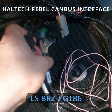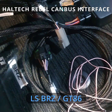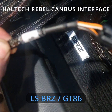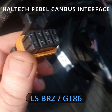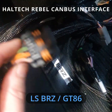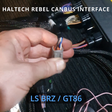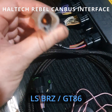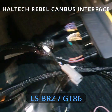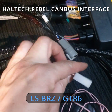I've got some plugs here for extra IO - we don't need anything for this at the moment, but you might want to add some features which you can add into these plugs here. The one we will need is this plug here, which is the one that used to go to the accelerator pedal - this will go to the translator, and the translator will then go to the pedal. The other plug we've got is the CAN bus plug, which we'll need to go to the translator as well. There's also a pink wire here which is the ignition on/off, so it will go to the translator as well.